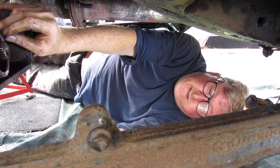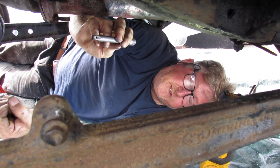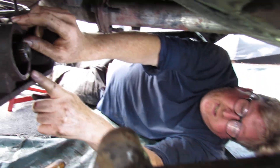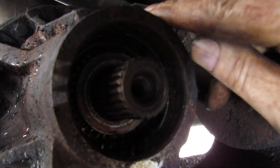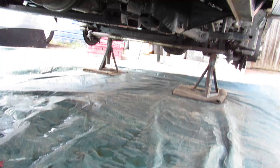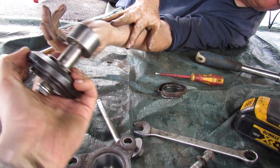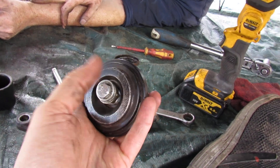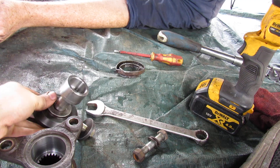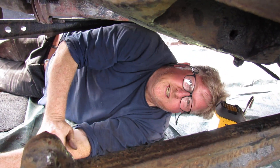So that's how you remove that part without any really expensive tools. That holding tool was a godsend because nothing would move — trying to undo things when it's so tight was a problem. Just make sure this area is really clean to put the new seal in. Also, this black cap is part of the G-clamp ball joint set — if you've removed the ball joints on the front you probably have this kit already. So you need that cap and the extension bar for holding everything still.